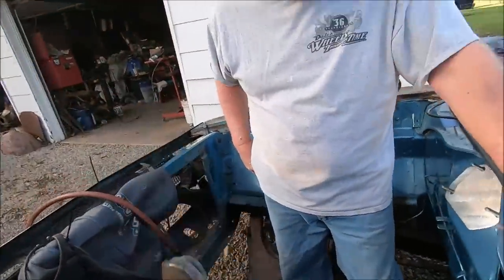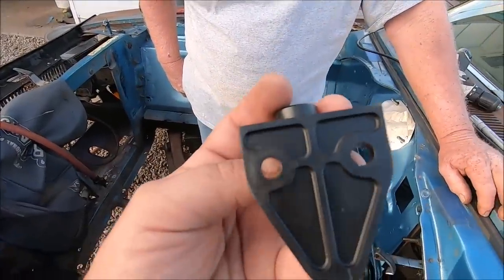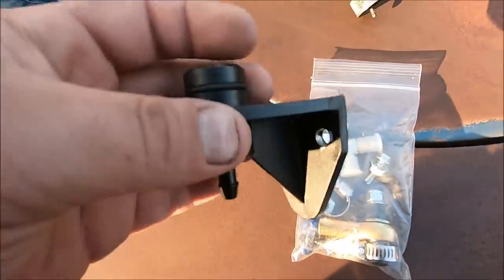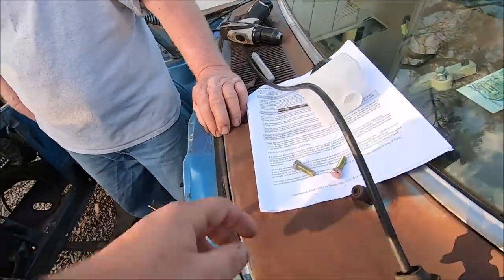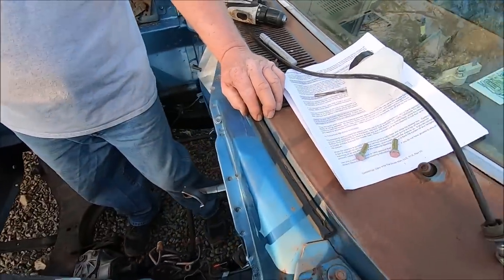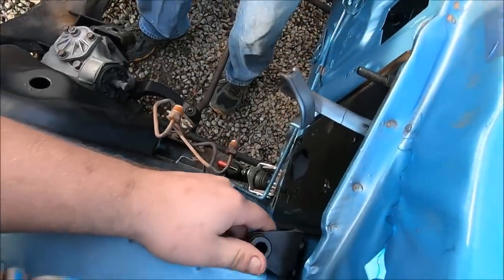And we're getting ready to, Mike was working on the spacer in there, and we're going to enlarge these holes because they're quarter inch. And they send you sheet metal screws to mount this thing. Sheet metal screws are not a permanent attachment. We're going to enlarge these holes, use some regular bolts, bigger bolts. What are those, 5/16? Yeah. And that way we got real good securation right there.